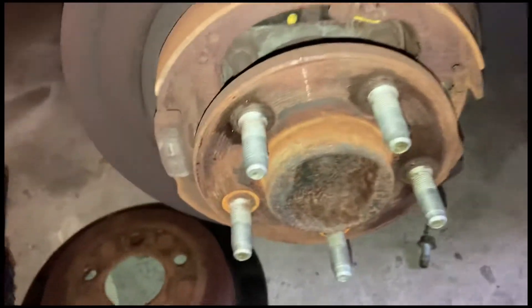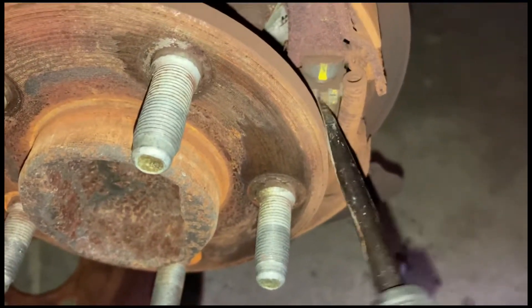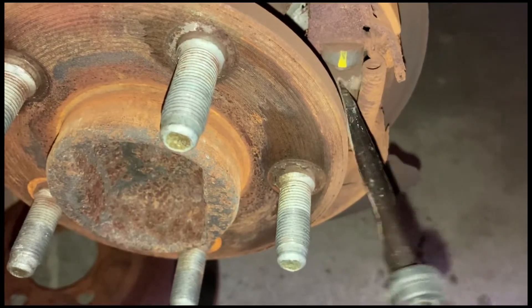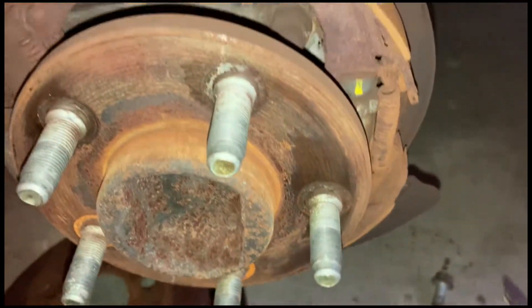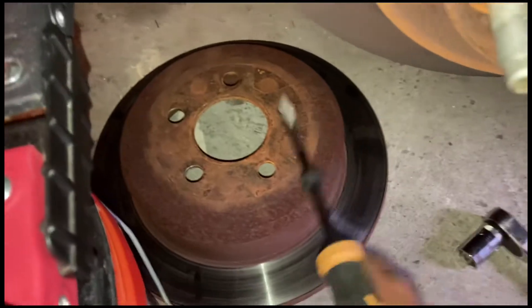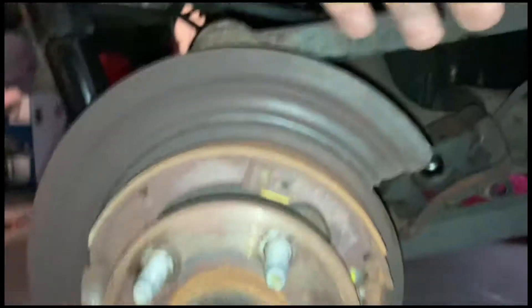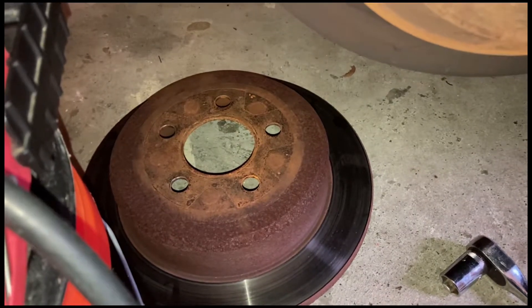There's this little adjuster screw here and I'm just gonna adjust it out. I don't have a lot of time. That's kind of weird because usually you have a little space in here to adjust that — I don't see any space. It's like you have to take this off. Oh, I think it's in the back — there's a little inspection hole with a rubber plug back there. Let's go ahead and put that brake rotor back on, then put new pads in and do the other side.